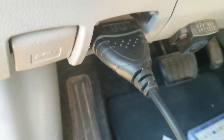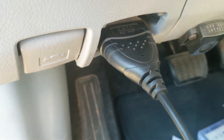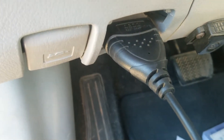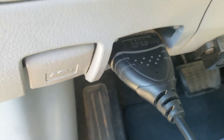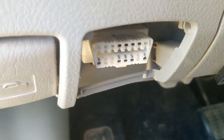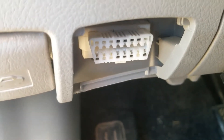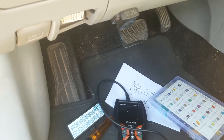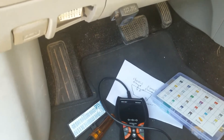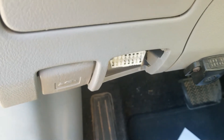If you're still not getting power and you don't have a blown fuse, or if that fuse keeps blowing, at that point you're going to start tracing the wires back from the OBD2 port through the wiring harness. Also, be sure to check pin 4 and pin 5 for a good ground, because those pins need a good ground for the scan tool to communicate. That covers what to do if your OBD2 scan tool is not reading anything, not powering on, or you're getting a no communication error.